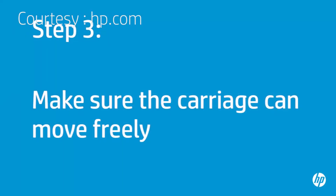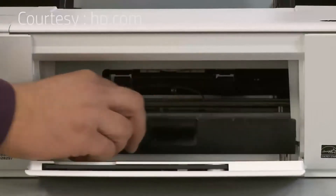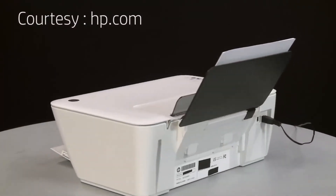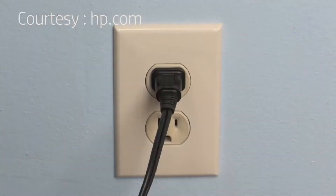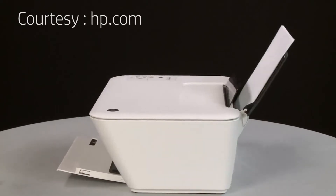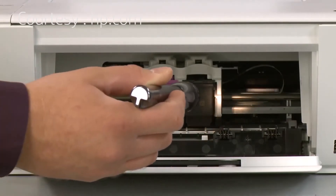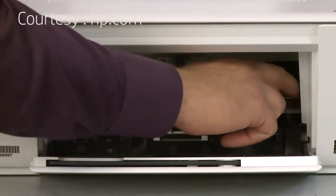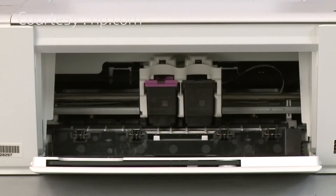Use the following step to make sure the carriage can move freely. The printer must be on for this step to work. Open the cartridge access door. The carriage might try to move into the access area — if it does, allow it to move to that position. Turn to the back. While the printer is still on, disconnect the power cord from the printer, then disconnect the other end from its power source. Return to the front. Look inside the printer and check for obstructions around the carriage that could prevent it from moving. Use a flashlight to thoroughly search the area and remove any obstructions found. Check the rollers and wheels for any torn pieces of paper that might remain inside the printer.